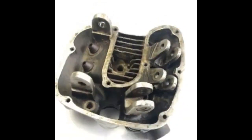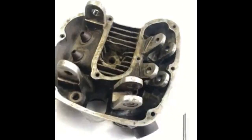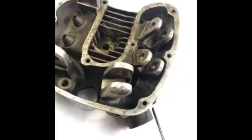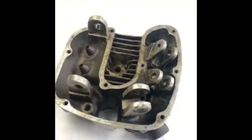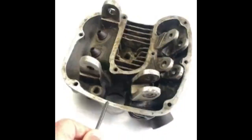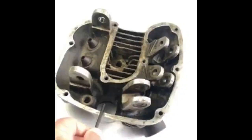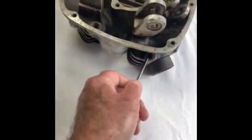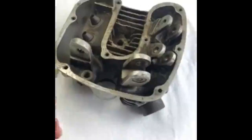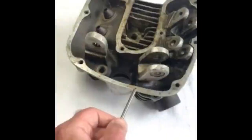So this is the 39 alloy Ulster head variant. Note that it has the extra 8 bolt fitting at the front, but has 15 fins across the front. It differs also in having a long reach spark plug and a thread for the pushrod tunnel at 20 TPI. It also has 3/8 Whitworth exhaust stub fitting bolts, and the rocker box cover bolts are also specific to this head in being that they are longer.